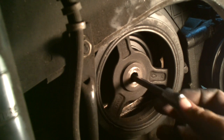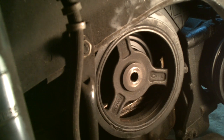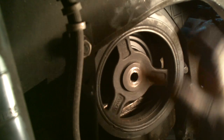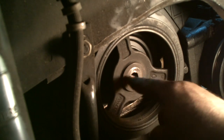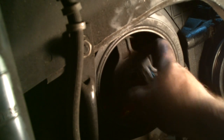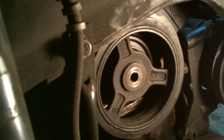For this style on the Dodge, you have to insert a rod in here. They have a special kit, but O'Reilly's, Advance, and AutoZone couldn't find the kit I needed. O'Reilly even called their distributor who handles the rent-a-tool kits — told them exactly what we needed and they didn't have it. Some pulleys have screws where you put a yoke and push through the middle. This one doesn't — you grab three places. They've got notches cut into this pulley and it uses this kind of puller.